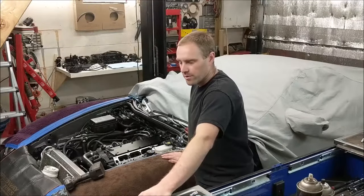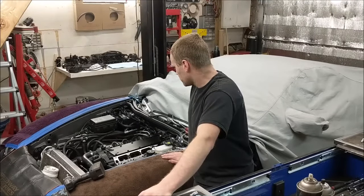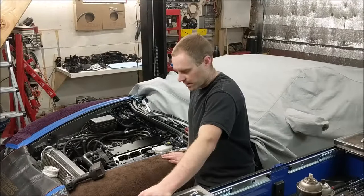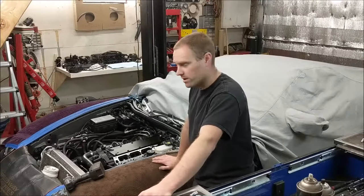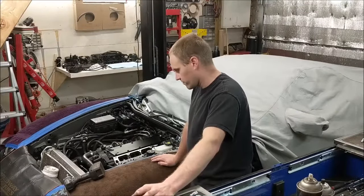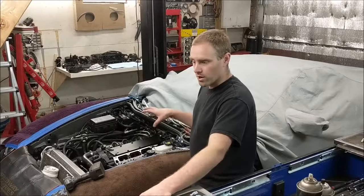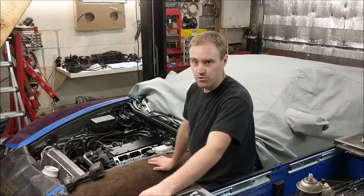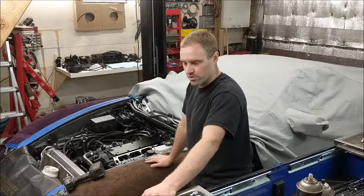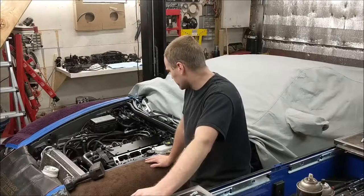So I'm going to clean up that edge, and then I'm going to clean up the carbon that's above where the top ring goes. That way the piston rings don't have to push that as well. Basically, the main thing is that ding, though. So I'm going to take a little sander. After I prepare, I'm going to have to protect the rest of the motor by covering it. I don't want any of that debris getting in there. The reason I'm doing it now as well, on top of preventing damage to the rings, is to keep that sanding stuff from going down into the bottom half of the motor. While the rings are there, it's fairly sealed up. It's hard for it to get past those rings. There's a small gap at the end of each ring, and they're usually offset. When I put the motor together, I set them offset. They don't always stay there, but you hope that they do, or at least they stay reasonably close.